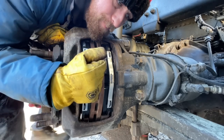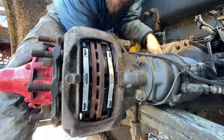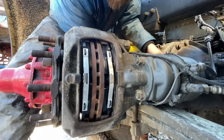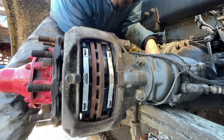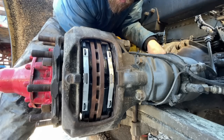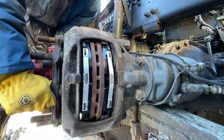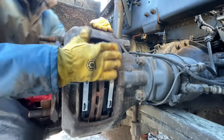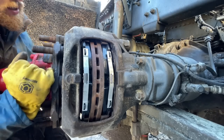How you adjust them up - turn your ratchet the other way. You tighten that. So that's fully tight. And I was always told two clicks off. So one, two - there's two clicks. Now that should move. Let's fit all the plating on, new pin, put the cap back on there, and we should all be good.